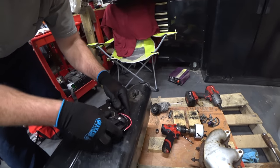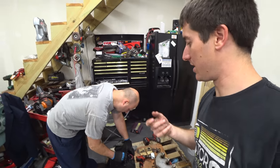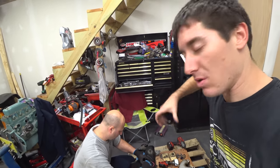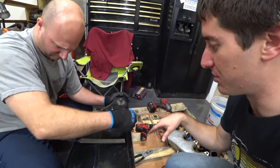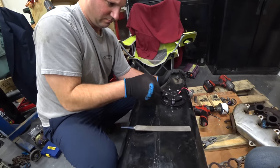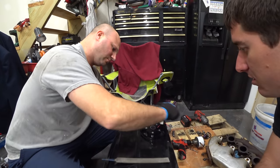It's like steel. Now you have to open up each one of these screws and they flip out like 90 degrees. So you back off each one just a little bit, and then you can rotate them and use that to lock the pump into your tank. After getting the pump back out, we were able to loosen up all of these threads here, and now you can see the gasket just sinking down there. So all that's left is wiring and a little bit of AN line.